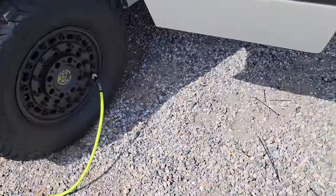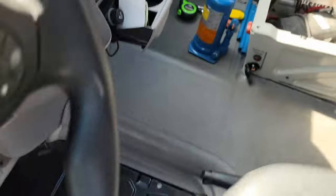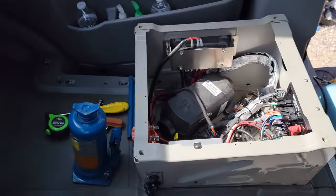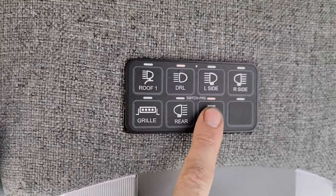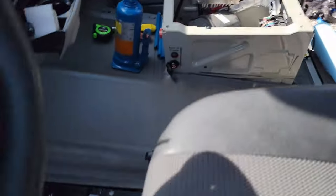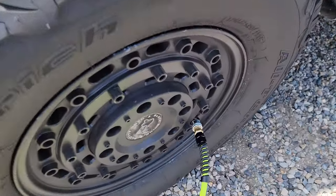I'll show you how the controls are set up here. I've been working on the van so I still haven't put all the flooring back in, but basically I'm controlling the trigger on the compressor through the Switch Pro, which is underneath the passenger seat, and then the controls for it are up here on the headliner. You can see I've got the compressor turned on right now. The compressor is not running because the pressure switch has been made, but as soon as we start filling the tires the compressor will start flowing.